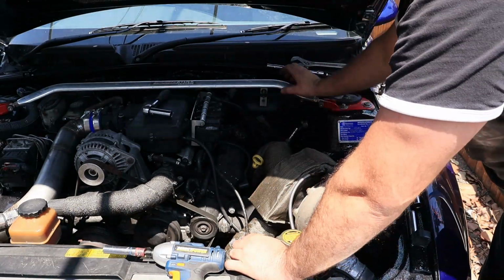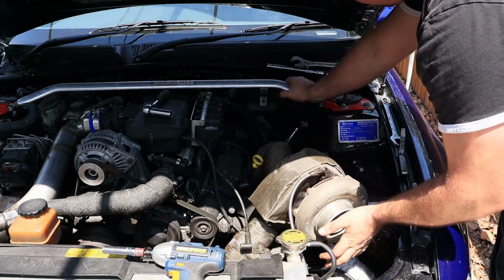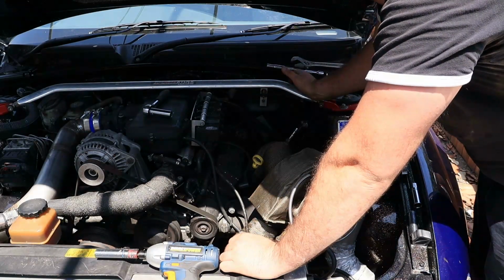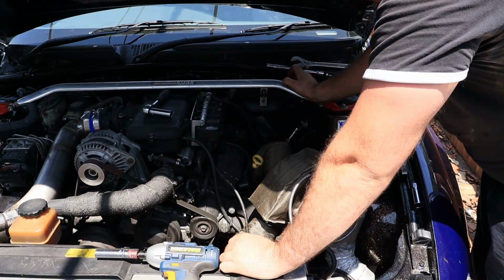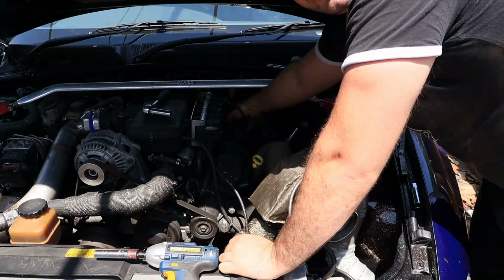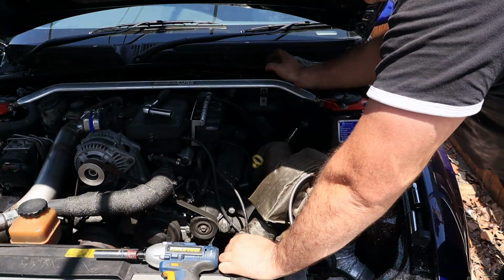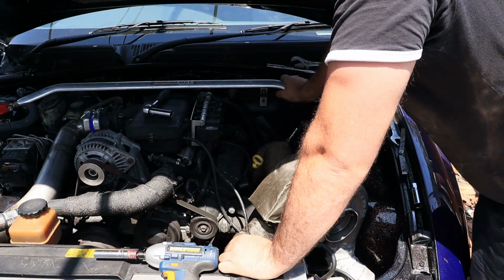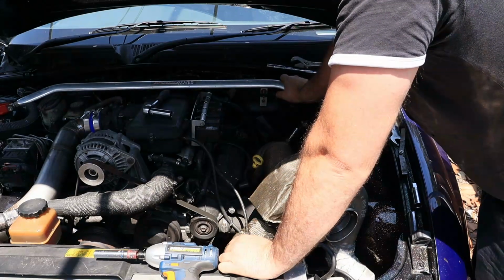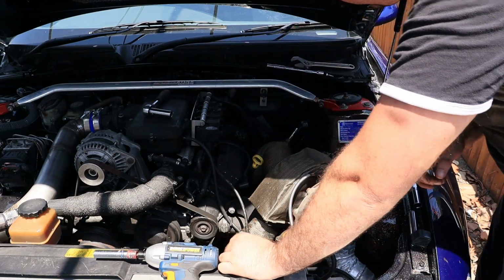Well, that's that side done now. I'm going to make a start on this intake pipe, and then I'll get this rocker cover off, and we've got to drill out the back of it for the fitting. Then we'll run the hose to it, and that should be about it. Oh, and then I've got to gap the plugs on the other side.